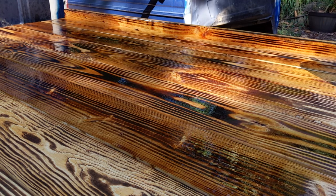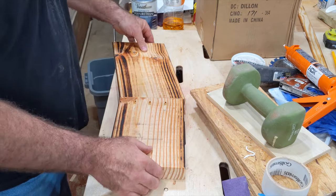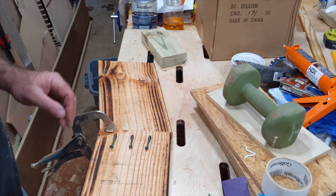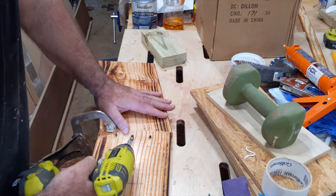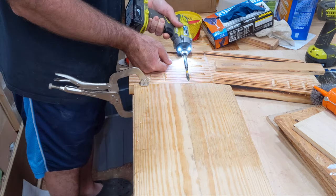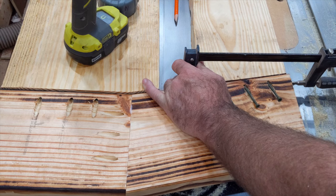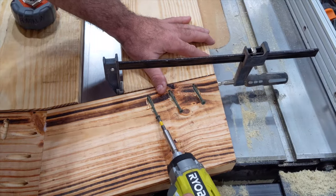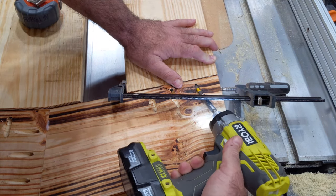But I think it looks fantastic. Now, I don't know what you call this part, but I need to build the wall that protects the cab from the things in the bed sliding into it. I wanted to follow the contours of the cab, so I figured out some angles and dimensions and cut the wood accordingly. I'm not going to give those dimensions and angles because your truck will probably not be the same as mine. Since I don't want a bunch of visible screws on this part, I'm using pocket screws. I'm only using the pocket screws as clamps because I'm using construction adhesive to really hold things together. I'm hoping the combination of the two will not only be strong enough, but stand the test of time against outdoor exposure.